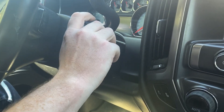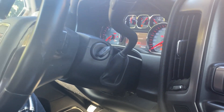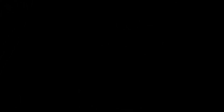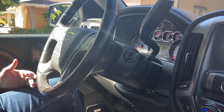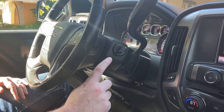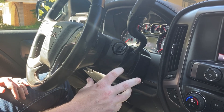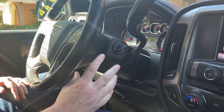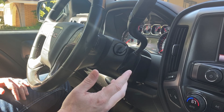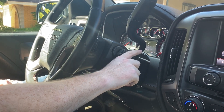So we're going to turn it to off, turn it back to on, and we need to do it one more time. Reset our timer. Now we're getting into our third and final 10-minute mark. I just want to give you guys a heads up that on the security light, on the third time, it may look a little different. Instead of just going out, it may flash once, it may keep flashing repeatedly, or it may just simply go out. The main thing you want to keep an eye on is your 10-minute mark, and then just look for a change in the security light.